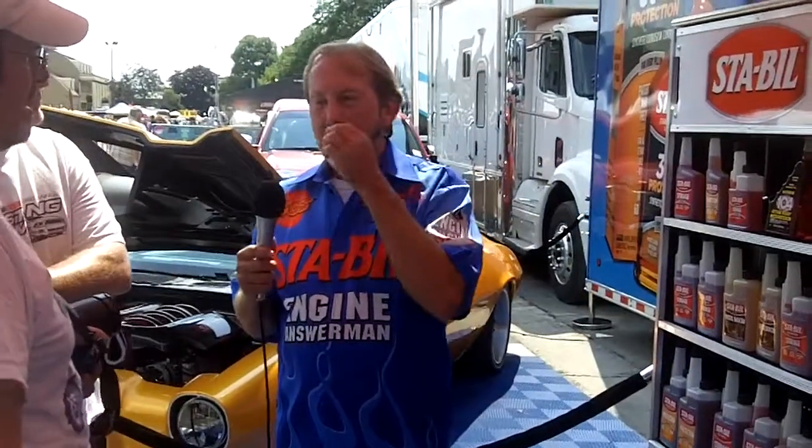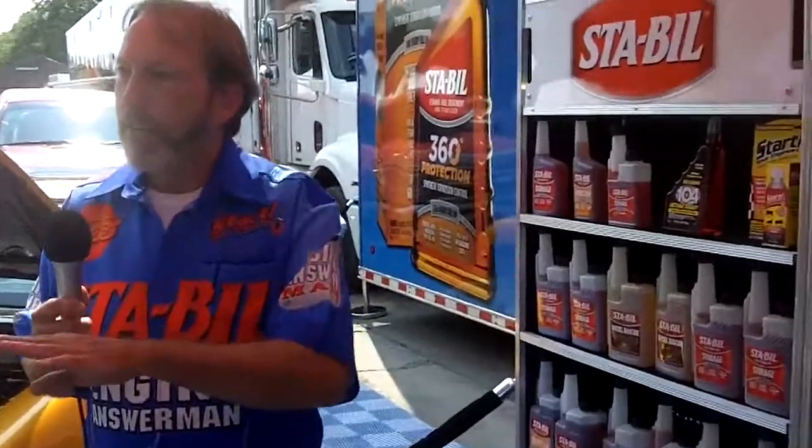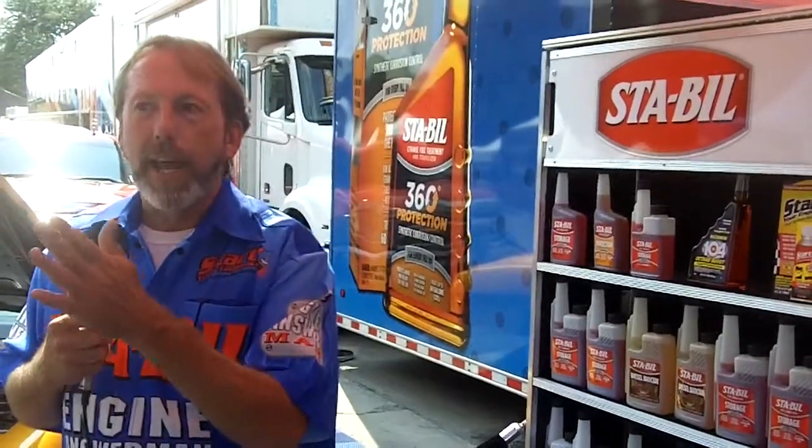But I can tell you that I've had a lot of questions like this, and a lot of people tell me the engines are different compressions, different fuels are different. What you have to do is use it in your car with 93 and see if it'll work. You might be surprised that it doesn't have to be 97. If you put this in with 93, it might even work with 91 octane. Do an experiment with your car because it's going to act different than the next car with the next fuel.